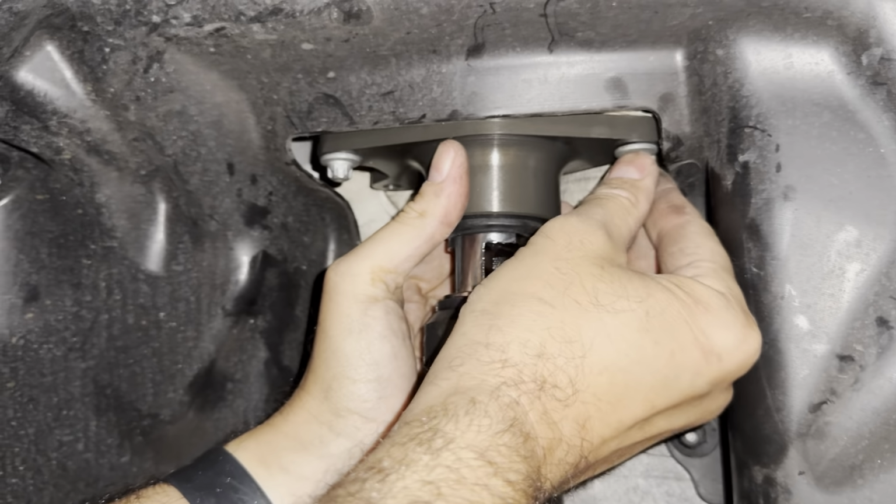Okay, that's the shock in position, the spring's in position, that's captive, that's definitely being held now. We're gonna get the torque settings and we're gonna crank all these down. Now the specs call for 5 mil of preload on the spring and 50 mil of droop on the coil, on the shock, so on the system itself.